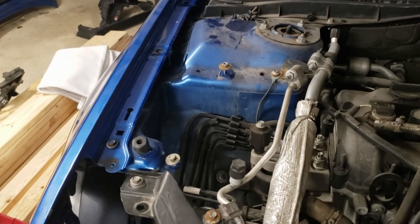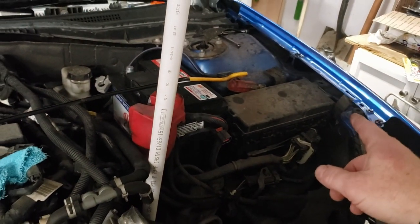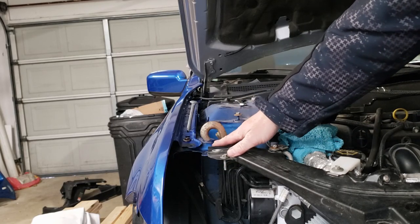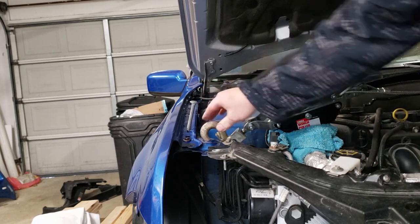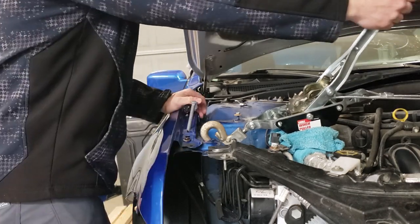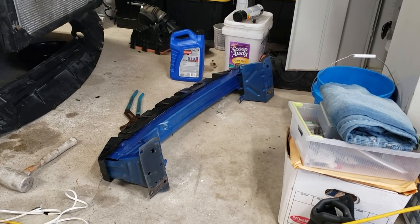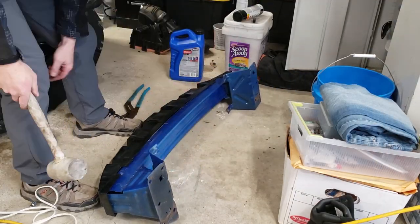What I'm going to do is try to use a cable winch. I'm going to hook it from this side to this side down here and just try to click it — see if I can squeeze these two sides together. This is the mounting point where it was originally bent — it's not the best setup. I'm going to try to give it a couple pulls. Well, I think that probably worked better than my original plan. This is a good bumper but some of the areas need a little straightening — overall the bumper is good.